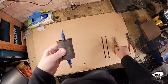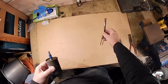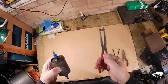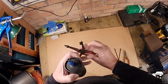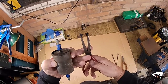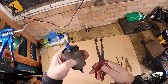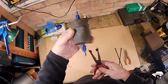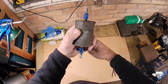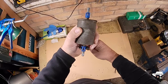What you'll need to do this is a pair of long nose pliers and two cable ties. What you do is fix the cable ties around the end of the long nose pliers, as I've done here, producing some protruding jaws. I'll just demonstrate so I can get that on these two clips and through the access holes — it squeezes it very nicely.